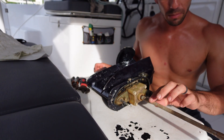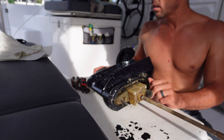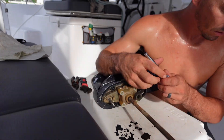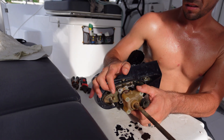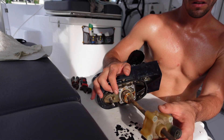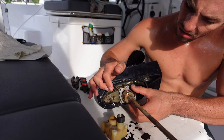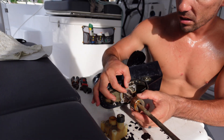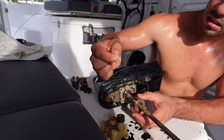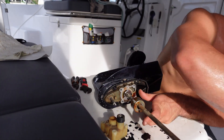The water pump impeller is right in there. First thing we have to do is take this housing off. Use a 10 millimeter socket to remove the four bolts for the plastic housing, also called the upper pump case. Slide the metal housing — also called the pump case liner — with the impeller up the shaft, and be careful not to lose the alignment key. Make sure to get that key out and don't lose it.